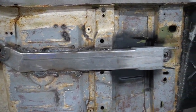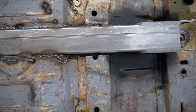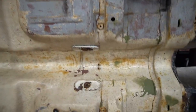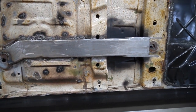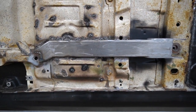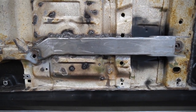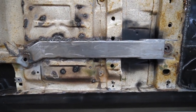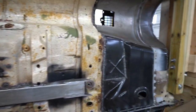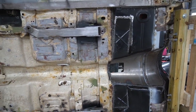I welded this on my back and it didn't turn out too great. Right here's a spot where I miss measured, so we're going to go ahead and take care of that as well. And coming down here, just clean up around here on these welds. We might have to touch up some welds with some more weld here, but that's okay. We'll eventually be putting another coat on the inside of the car as well. So we're going to go ahead and get all this stripped down, get all the welds cleaned up, and hopefully hit this with some epoxy primer.